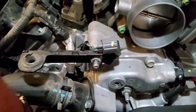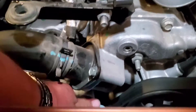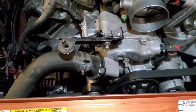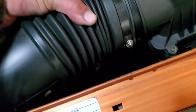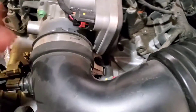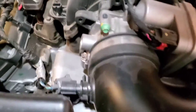Go ahead and grab a rag and just dry the belt as much as possible where coolant fell. Now that we have everything nice and secured, let's go ahead and put the intake piping back into its place — right in here first, just like so, and this one right up here. And put this right in there to secure it.